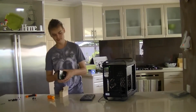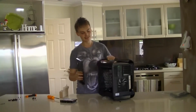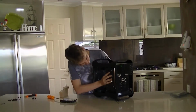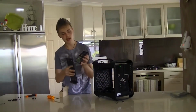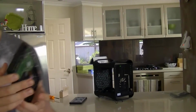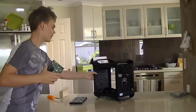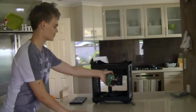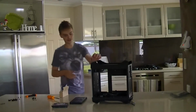So we're going to mount the drive in the case, and you've got to kind of do some imagining. So in this case, this drive holder sits in like this. Actually, it goes on the inside, but it sits in like that. So we want to mount the drive so it's on the inside with the SATA connector. I'll show you the SATA connector. So that this SATA connector right here is on the front side of the case, so it's up front here. So basically the drive needs to go in this way. So we've got to do some imagining and find out where it's going to go.